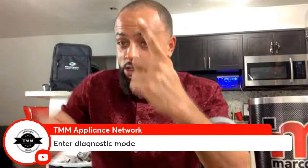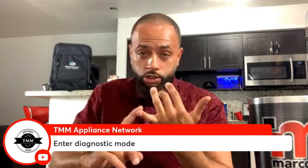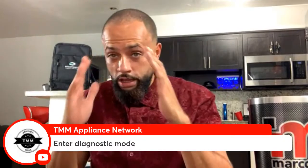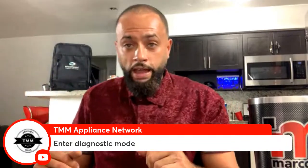Again, let's start at the top. Number one, we said rely on your theory. You go in there off rip. You're supposed to know how this unit works: specifications, outdoor temps, indoor temps. You're supposed to know top to bottom all the parameters of this unit. Step one. We said step two, retrieve symptoms and error codes. While you do, you investigate the gadget, checking this, checking that, checking all over the place. You don't see nothing? Enter into diagnostic mode, retrieve the error codes.